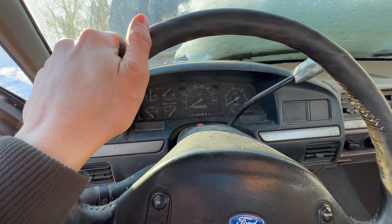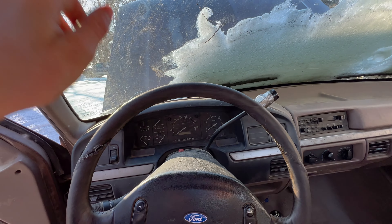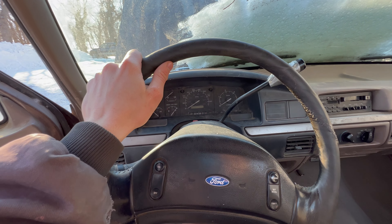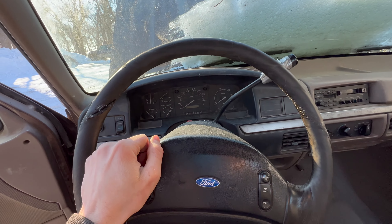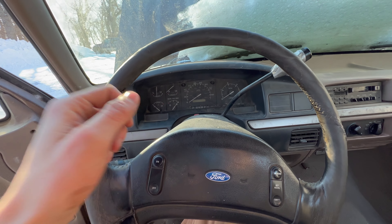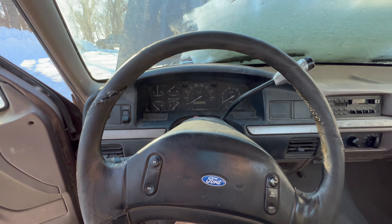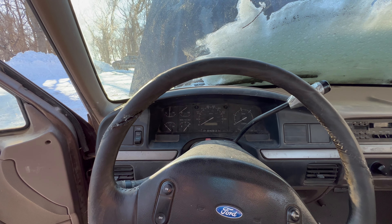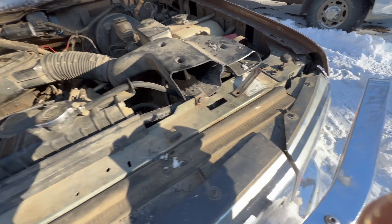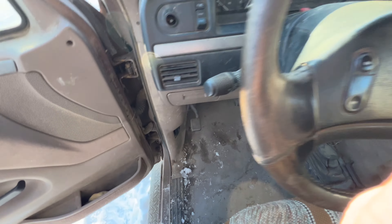This Ford IDI won't start without glow plugs — trust me. Those glow plugs are old; I've never replaced them since we've owned this truck since 2001. So it's best to replace them, and it's a pain to get them out of the cylinder. Thanks for watching — looks like we'll have another project this year. Always something. I don't like doing this but I'm gonna give her some ether since the glow plugs don't work anyway. They can go on and charge the batteries.